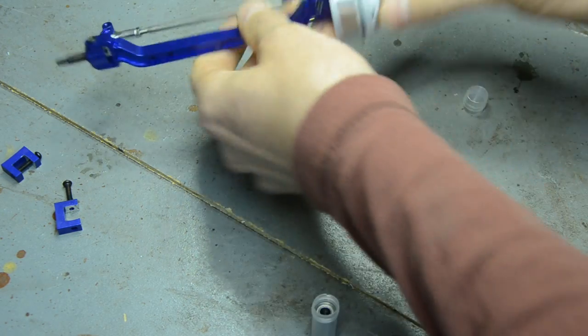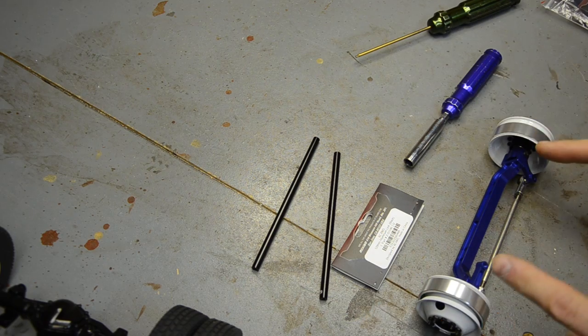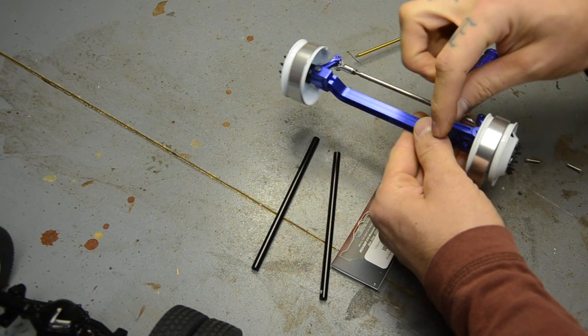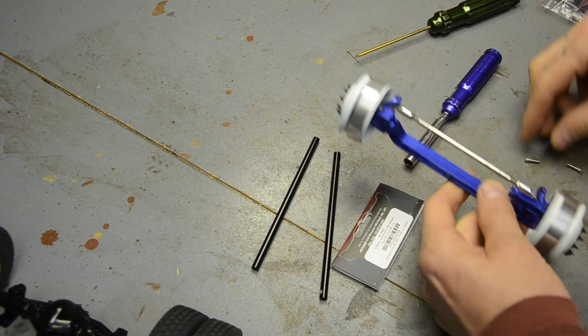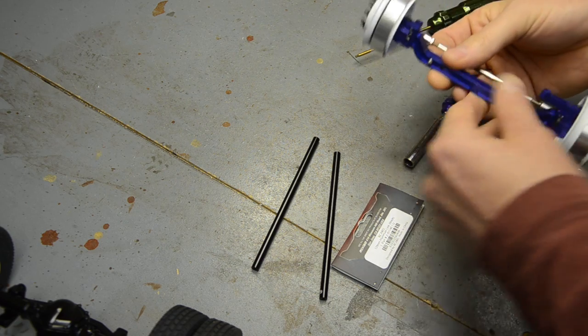So I don't have any front tires yet, but I'm going to get the body and stuff out and we can start looking at chassis designs. Alright, so I'm going to go ahead and throw some radius arms on here. I'm probably going to have to flop the hubs, the knuckles, because I do want my steering arm in the front, but I need my turnbuckle on the other side, on the driver's side. So that's something we'll have to look at doing here in a little bit. I've got some scale bolts here, and I'm going to, yeah, that'll work.